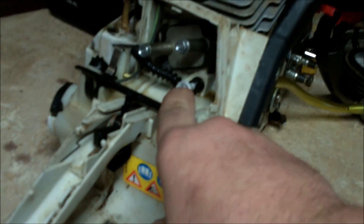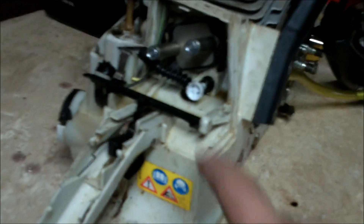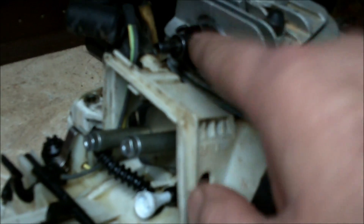Back to the saw — you want to block off the intake and your impulse hose that goes to the carburetor. Block it off with something like a golf tee, but not sharp. I don't recommend using a wood golf tee because sometimes it'll put splinters in there and get stuck when you pull it out. The only other thing you need to do is install an adapter to pressurize the saw. This one has a hose nipple on the end — 14 millimeter threads with an o-ring around it to keep it from leaking.